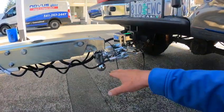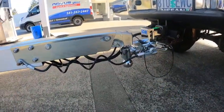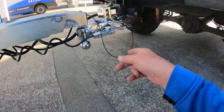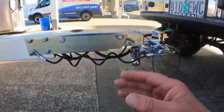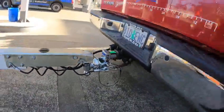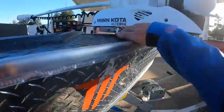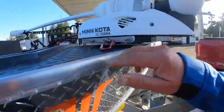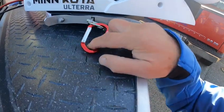If you're only at 16 inches, you better get it up to at least 20, or you're going to be way low. Breakaway cable for the brakes — if it pulls away, it'll lock the brakes so it doesn't jackknife and go all over and ram into the back of your truck — like has happened. Anyway, put a carabiner on this for double security.